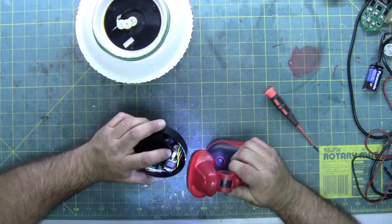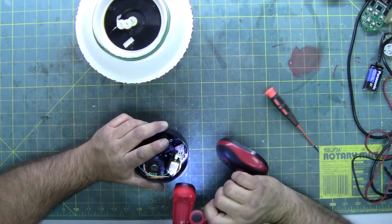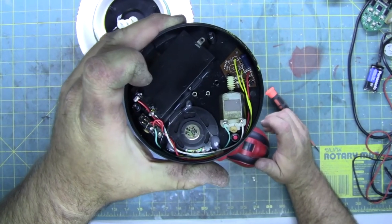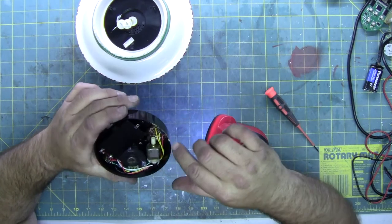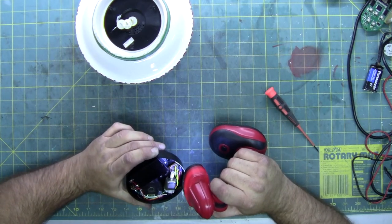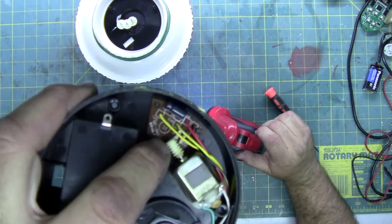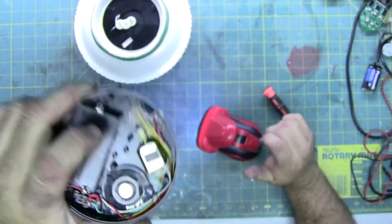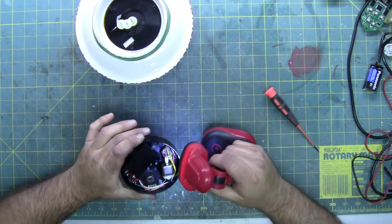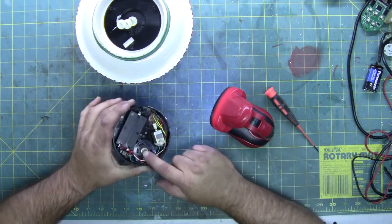That crack could be enough to break the friction tension on the shaft. The electrical circuit board — I'll get a little closer so you can see what's inside. That's the worm gear I'm talking about. The electrical components — the resistors and the capacitor — look good; they're not discolored or bulged. I'm assuming on the back side of this circuit board there is a blob chip, because it says IC for integrated circuit. The little chip that plays the music is attached here, which sends it to your speaker right there.